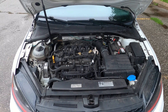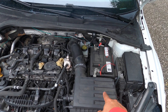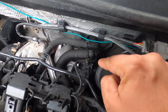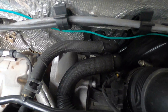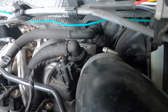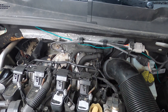To understand how a turbo inlet pipe works and what it does, we have to understand the airflow in the engine bay. The air goes in through the air filter, then travels through the accordion hose into the turbo inlet pipe, which leads into the turbo itself. Here I have a CTS Turbo inlet pipe — it's the pipe that connects the accordion hose from the air box to the actual inlet of the turbo.